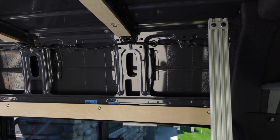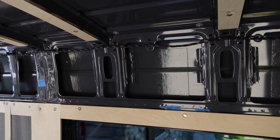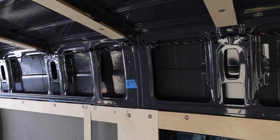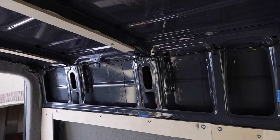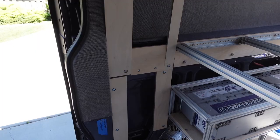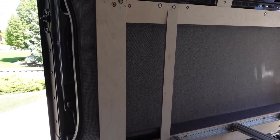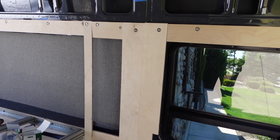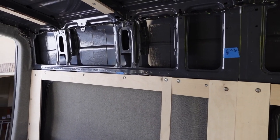And that's it — I've got all the furring strips in. On this side I'm going to have upper cabinets, so I didn't put any furring strips there because I'll just be attaching them to the ceiling. You want to make sure you have them everywhere that you're going to be attaching anything. I'm going to be doing shiplap, and if you're going to be using something like quarter-inch birchboard to cover your walls, you probably don't need as many furring strips. But because I'm doing shiplap, I need to make sure I have points to attach every piece. Hopefully this video helped you in determining how you're going to frame out your van — see you in the next video.